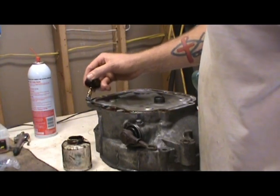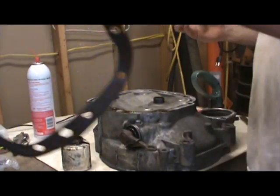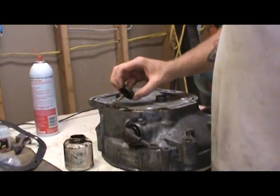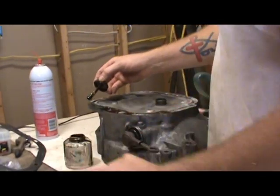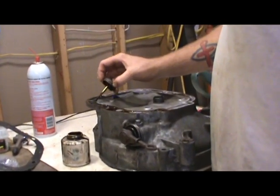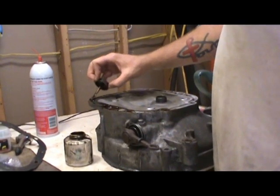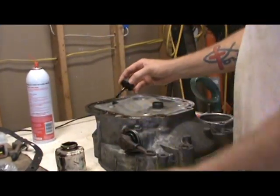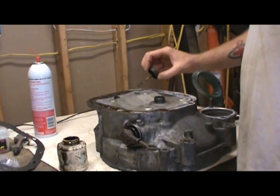I'm just using my aviation here, just brushing a thin coat on. Normally if I don't have a gasket I'll just use some RTV, regular old Permatex sealant. But my builder put a gasket on here when he built the freeway flyer for me, and it's in really good shape. Since I do have a gasket, I'm going to use the aviation and the gasket and we'll seal it up with that. It doesn't take much. I'm going to go ahead and get all this on, put my gasket on, do the back side of the gasket, and then we'll bolt it on the transmission.